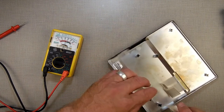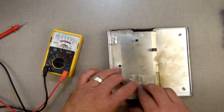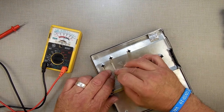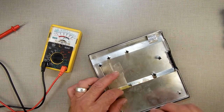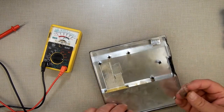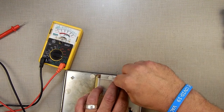So, what I did is I take a piece of tape, I lay it down in here, where it's broke, secure it down so that this is being held together so that it won't come apart any further. And I don't want you in my way. You're getting caught on there. Then I'm going to take a razor blade, trim off the excess along the edge of the membrane.